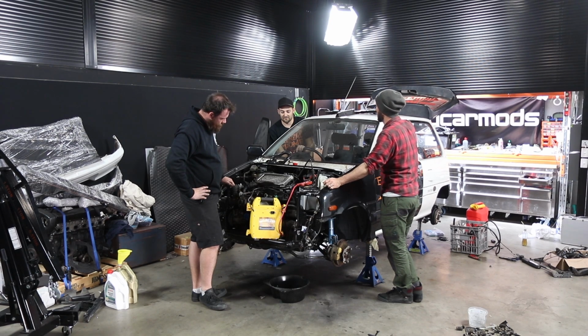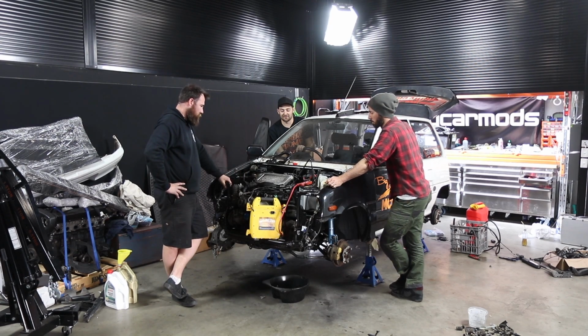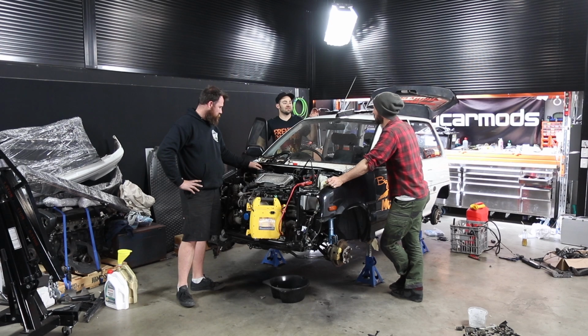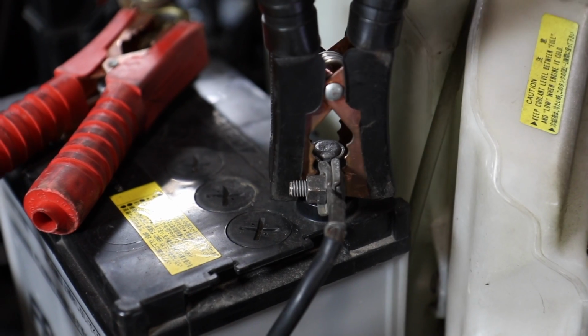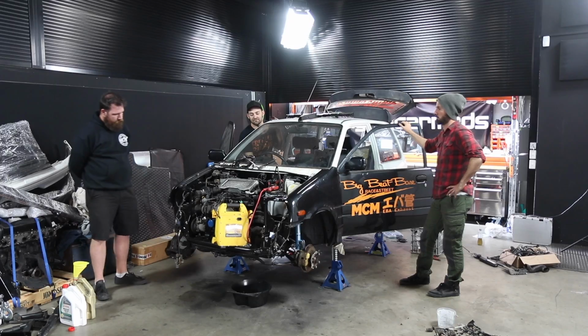There is fuel in the tank, spark at the plugs, and the engine turns over. But crank as we might, it just won't run. By letting this half cut sit around on the shelf for so long, we may have made things difficult for ourselves. The engine just isn't getting any fuel delivered. Our next solution is to try a starting fluid, which can be sprayed into the intake, giving the spark plug something to ignite, and hopefully get the engine running.